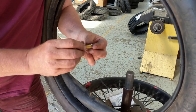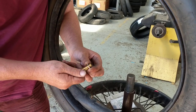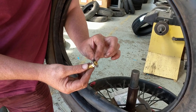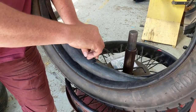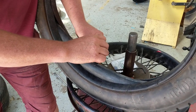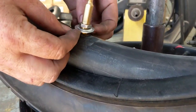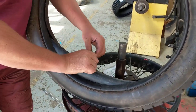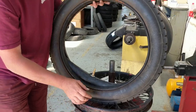What we do is put the nut slightly up the base of the valve stem like that, screw that up a little bit, and then put the washer on there. All of that screws onto the inner tube. What we've got is the concave side of the washer against the inner tube. All of this is going to go inside the tyre. The plan is that the washer and nut are there to stop the inner tube from blowing up around the valve stem in your rim.